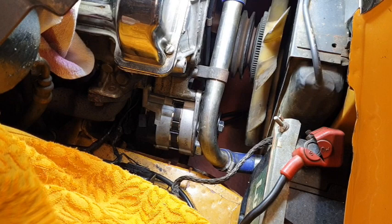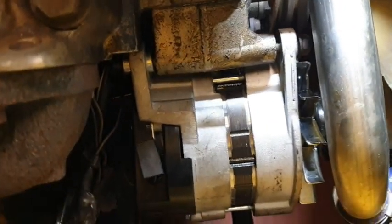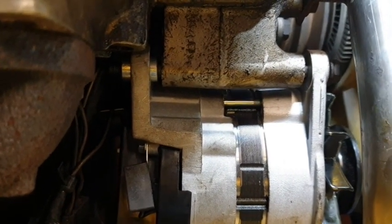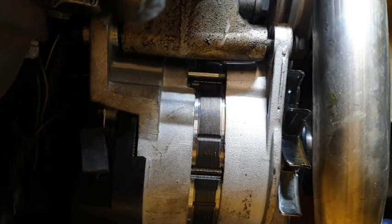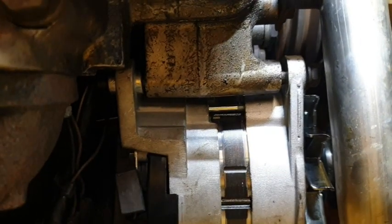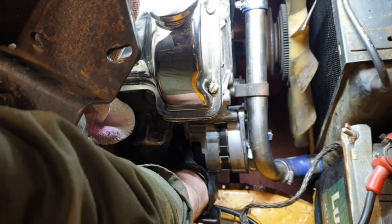Get that washer on. And one of the things I've discovered, you can probably see a bright piece that side. This alternator must fit other manufacturers, and so that will just adjust up so that it comes up nice and snug to this side rather than that side. So I'll just push up to that point there, so it's just basically taking up a little bit of space for where I want to get my nut in, but we'll do it. Okay, so I've now got her secured nicely.